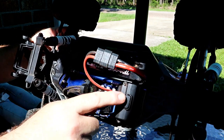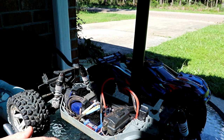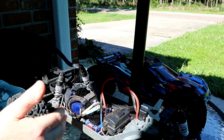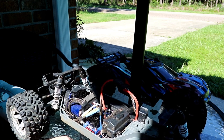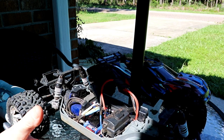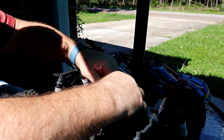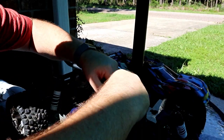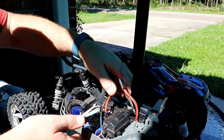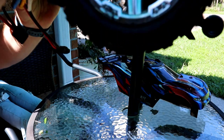The fan will go in here underneath this cover. Yesterday I took it out and was running it around the ball field, and a little bit into it it started to reduce power and then shut down — here on the speed control was flashing real fast red, which means it was in thermal protection. So I can't even run a whole battery right now without overheating. Then again, my GoPros and everything else are overheating too — they're shutting off in this heat. That motor is hot.